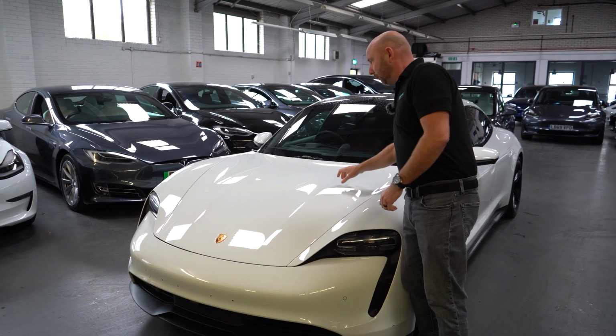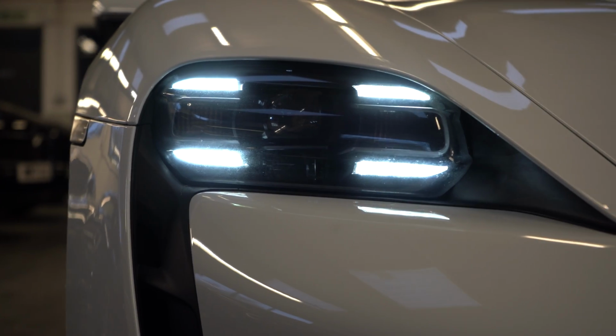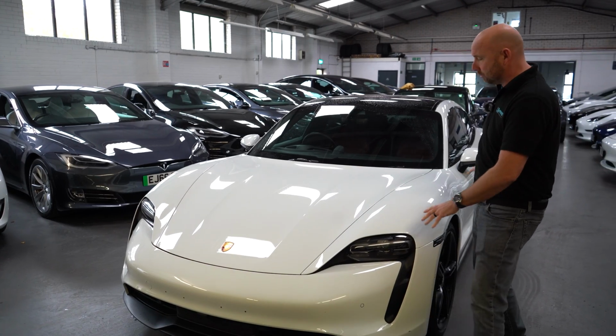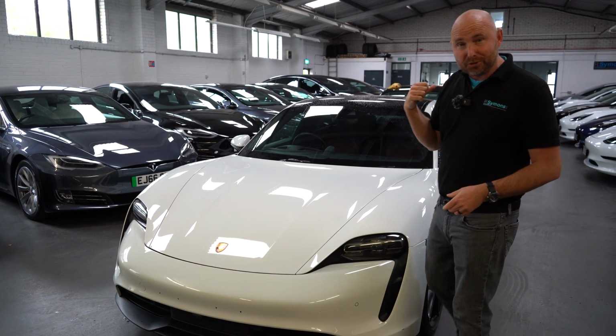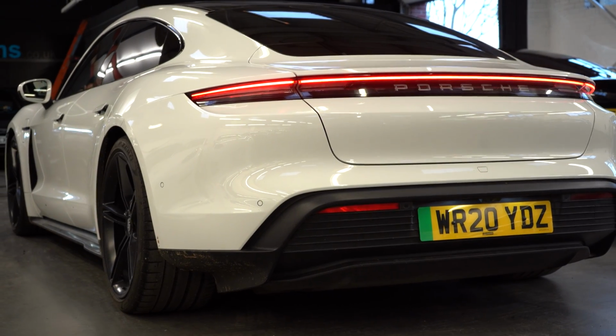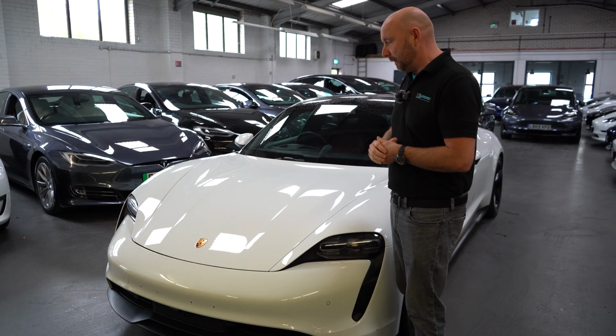But I think especially the bonnet, partly because you're reaching across, was really hard to do. It was really stuck down well because probably the heat and the sun on the bonnet especially. The wings and the doors not so bad. And then the spoiler was the hardest bit actually. That's because that's plastic and you can't really heat it up and build heat into the bodywork there to make it easier to peel away.